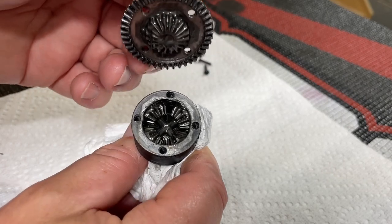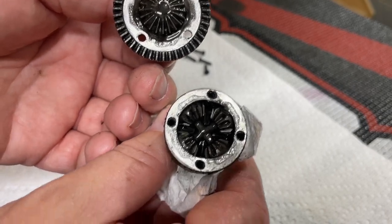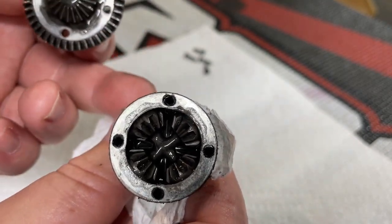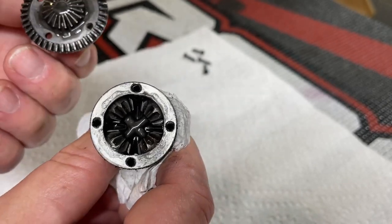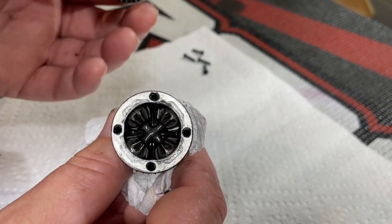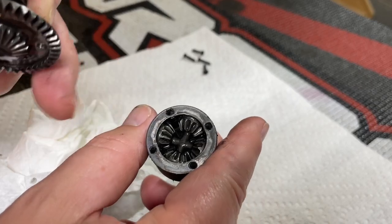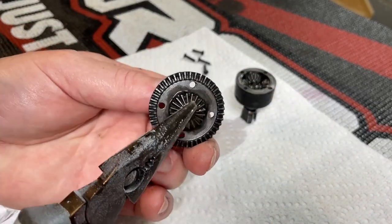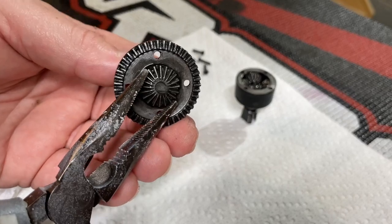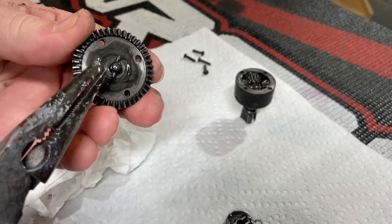With the screws out and the top lifted off, I can see part of my problem right now — it might not even have been a matter of fluid thickness. There's just hardly anything in there. I apparently lost some fluid in this thing. I don't remember the last time I tore the front apart, which is a big reason why I'm doing it now before heading out in the next few days to try another personal best record jump. This is the sun gear — if you lose drive and you can feel it just spinning freely in there, underneath the sun gear is what I was mentioning.